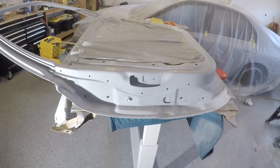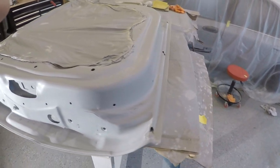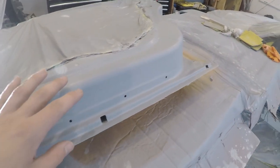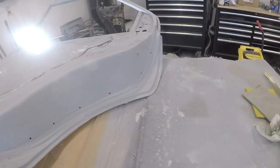Basically, I got everything all primed and sanded. I wet sanded everything with 600 grit and it's looking really good. So we're ready right now. I got it all cleaned off. I just got to tack rag this before I go ahead and shoot it with base coat,